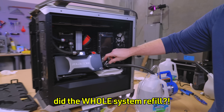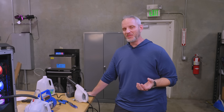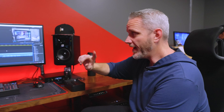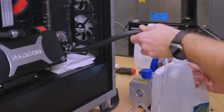I think we're going to find out. Let's close that off — yeah, it's full. Is it really? Yeah, the pump's turning. You can even see the red fluid that was still in the rad coming out right there. Life just got so much easier. We're pausing to explain — we figured out where the air came from. When I lock the valve off and take the hose off to dip it into the bottle, the hose itself is full of air. So that vacuum pulled fluid and air back into the system together. If I had two valves and could keep it under vacuum while dipping the tube into the fluid, it would have 100% filled the system. But because there's air in the tube, that made its way back in. I'll take a little bit of air versus what we normally have to deal with.